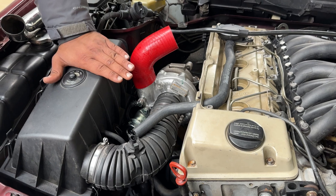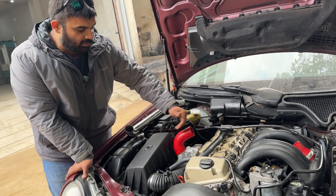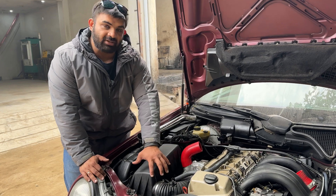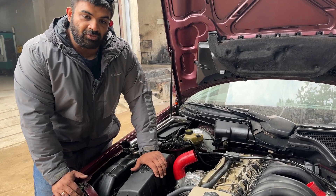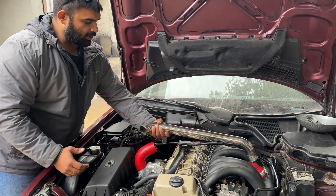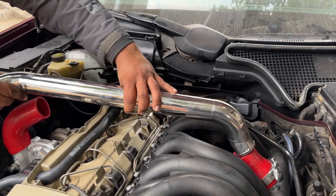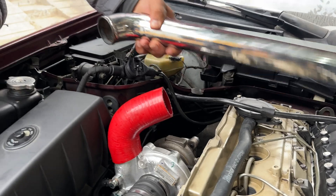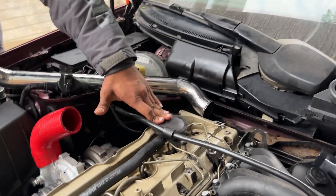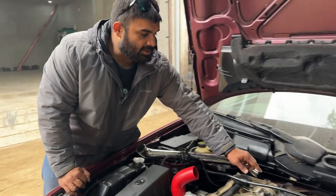The air sensor will be retained. We've retained the stock inlet pipe, the air filter is in the right place, and the turbo is now in position — it has been placed beautifully. I don't think we've got space to fit a bigger turbo here unless we bring it up or do a conical filter with a new turbo placement. This is going to go that way, and the inlet will get completed. This was the crankcase breather, which is a stock fitment on the OM605.